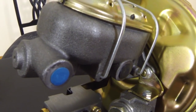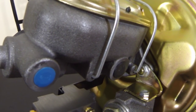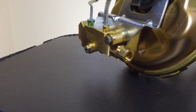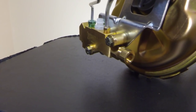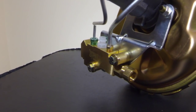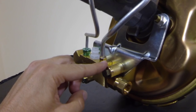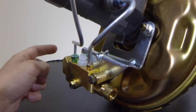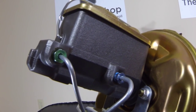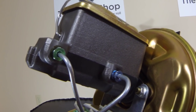The master cylinder — as in all GM master cylinders from 67 to 81 — has a 1/2x20 on the front port and a 9/16x18 on the rear. This brass block is a 1971 through 77 GM midsize vehicle combination valve. The large port that feeds the rear brakes is a 9/16x18, with a 1/2x20 as the other port, 7/16x24, and then the two front ports — one on the top and one on the bottom — are both 3/8x24. Again on this master cylinder, as on all GM master cylinders 67 to 81, you have a 1/2x20 port on the front and 9/16x18 on the rear.